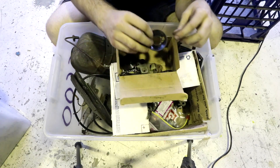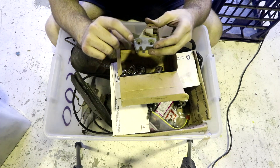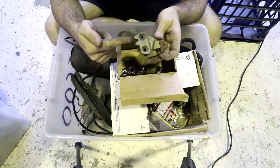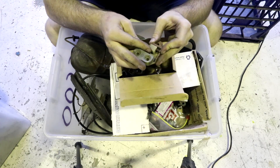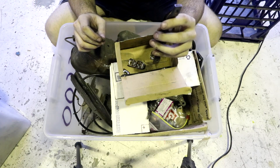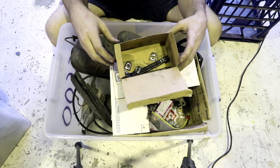So far this video is a lot more interesting than the last one — these boxes have way cooler stuff in them. These are the piece of trim that goes around the base of the window winder, so window winder trim times two. That is a door striker. A normal car door latch has a little hook when you close it — it latches. The S600 has this really weird thing — these are like rack teeth, and there's actually like a gear on the door. When you close it, the gear engages into these teeth and rolls in and holds the door closed. And then this pops it open or pushes it back. So it has a rack and pinion setup for the door latch — it's really weird but it's cool. These are the interior door grab handles with little chrome ends for them. I'll call these door grab handle. Looks like I have two of them and four pieces of trim.